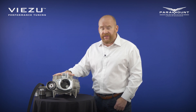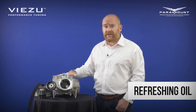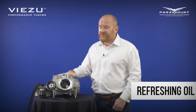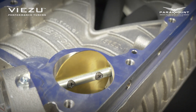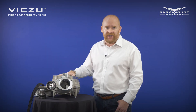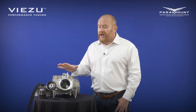Generally, other than those two issues, these chargers are pretty much indestructible. They do have oil in them, and officially it's not part of any service schedule to change it — they're a sealed unit for life. However, we always recommend that if you're working on a car that's done 80,000–90,000 miles, certainly at 100,000 miles, or if you're taking the charger off for any reason, it doesn't do any harm to change the oil while you're at it.